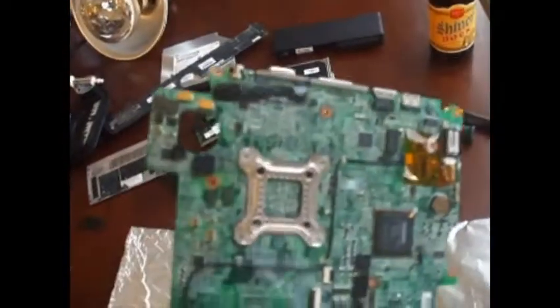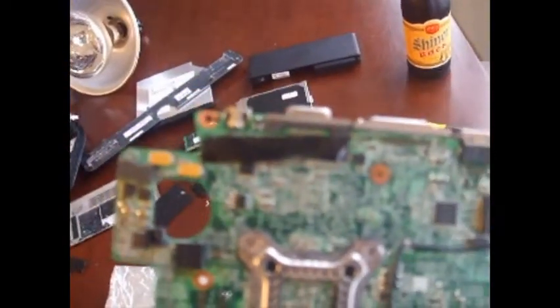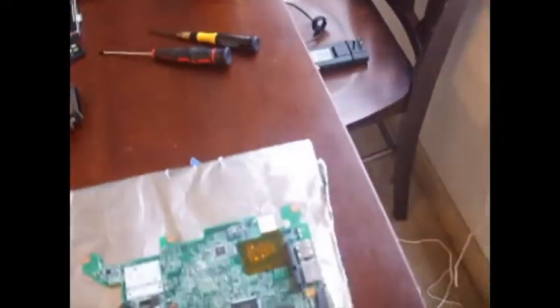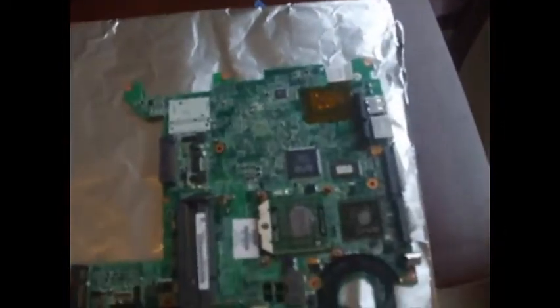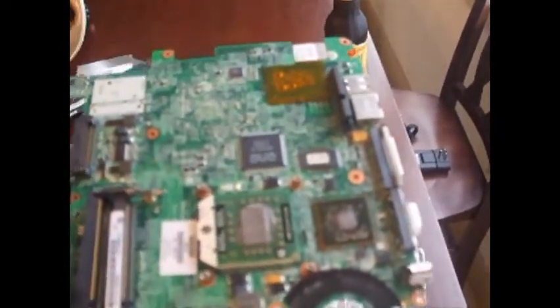The goal is to take this chip, put it over the hole on the underside, and then use this heat lamp right here and cook it. We're going to cook it for probably about two minutes to get everything nice and hot. The soldering around the edges of this chip and on the bottom has come unsoldered because of the heat this motherboard generates. It's an HP defect and they haven't owned up to fixing it, so we do it ourselves with a heat lamp.